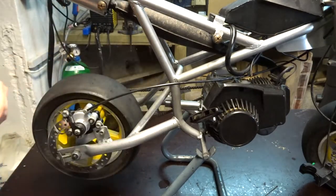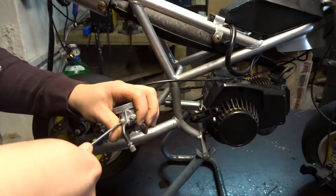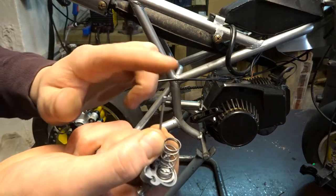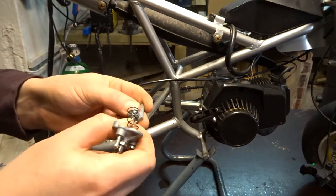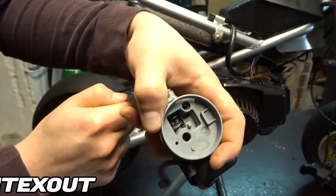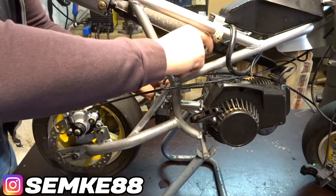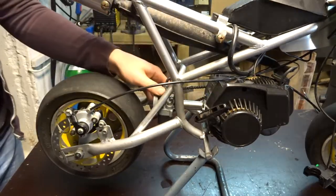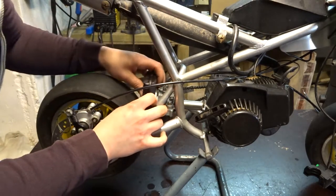Here is the old one. Now let's connect the new throttle cable to this carb. I'm gonna have to grind this down a little bit to adjust the fitment. Yes — now we have throttle. Now let's install this carb. It sits on good enough. Now let's get the air filter on here.